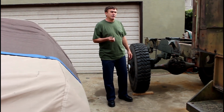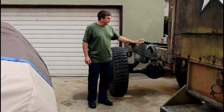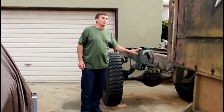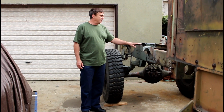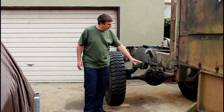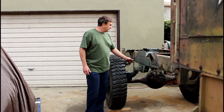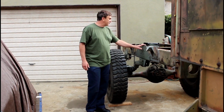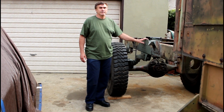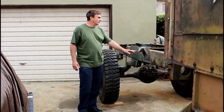There's a few things I would have done differently, and one of which would be I would have this one plate remade. So I'd have to find somebody with an iron worker and redo this quarter inch plate right here. But it'd be a heck of a lot easier just to remove the rivets rather than all the cutting I did on the bogey mount and then making it smooth on the underside. Aside from bending the quarter inch plate in a 90 and adding your rivet holes, it would have saved me a ton of time just having it bent and then drilling the rivets back in.